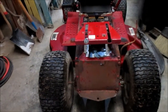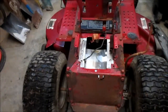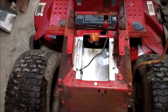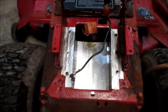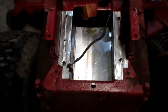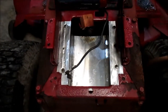I've done a lot of work on the engine and put some new belts on it not too long ago. This is a neat little battery compartment I built myself — the original one rusted out and actually broke in two. What I did was I took some ordinary flashing and put two layers of it together and did all the folding and bending necessary to make it fit in there. That's where the battery sits, and that project worked out very, very well.